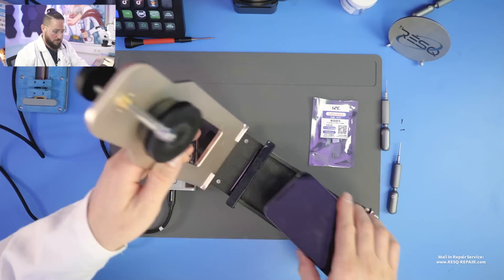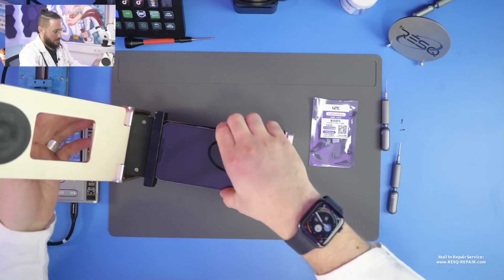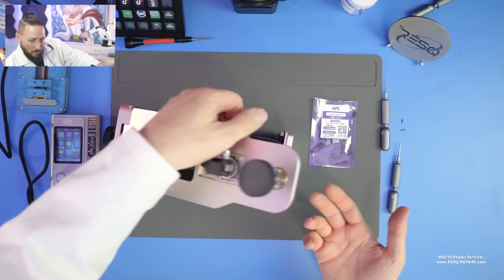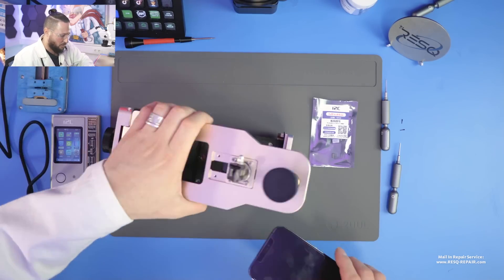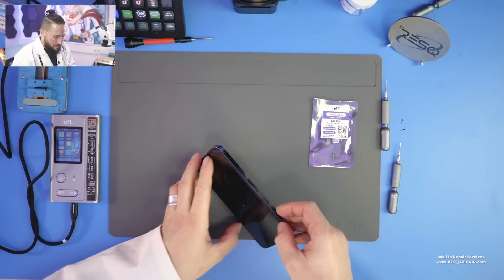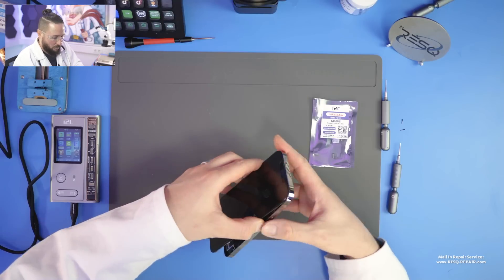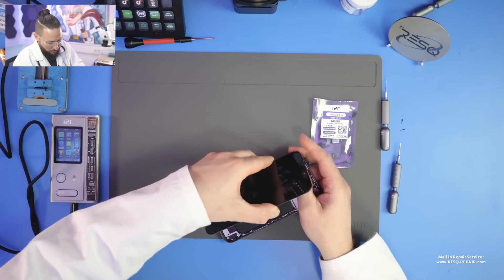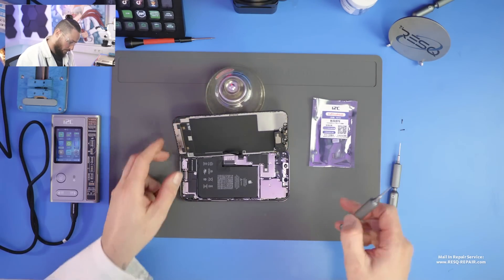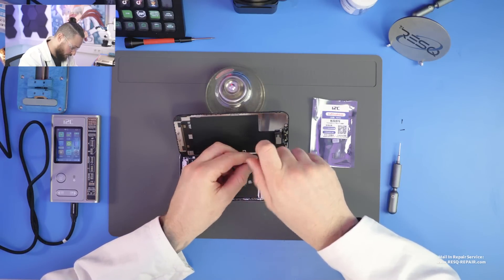The device is heated up, so we take our Refogs RS50 — I just love it, we use it every day here in the company. It's a cheap tool, you get it for about 60 to 70 euros. For that money it's a great tool. So we need to take out the screen like this, and after that we open up these screws here.